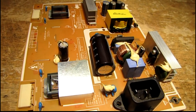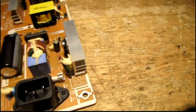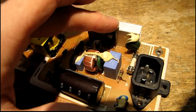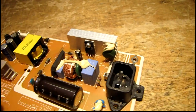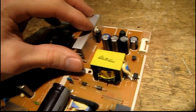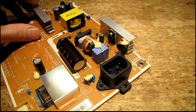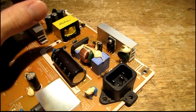I've removed the power supply since I confirmed it wasn't putting out any voltage, and there was no sense having the rest of the TV up here until I fix this. I found a dead short across ZD102, this little Zener diode here. I'm really suspecting that IC101 — the chip on this heat sink — is the actual problem, because this is the main switching IC. It handles all the current for this TV, drives the transformer, and generates 14.5 volts through the rectifier and filter caps to run the rest of the TV. If this thing got hit by a surge or just plain worn out from use, this chip is probably going to be one of the first things to go.